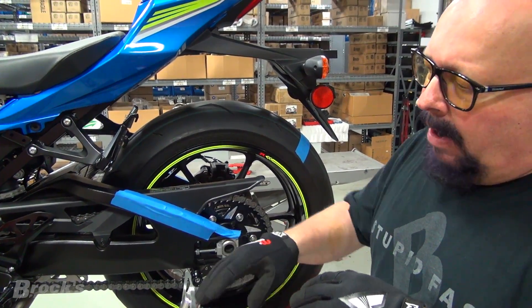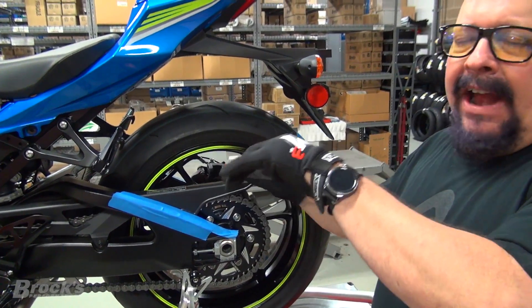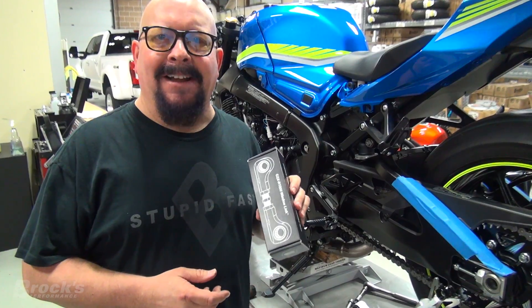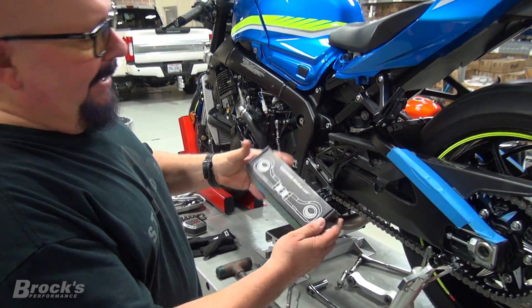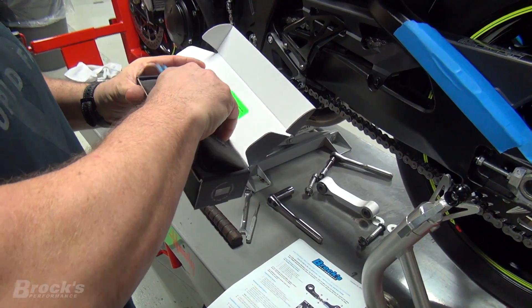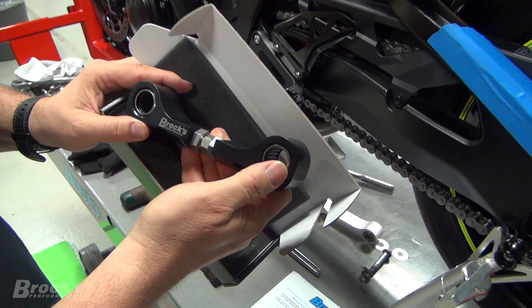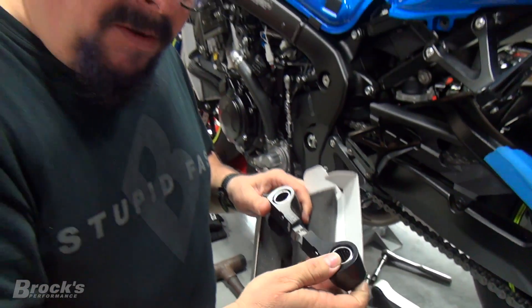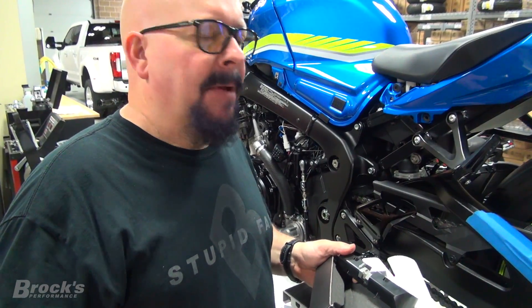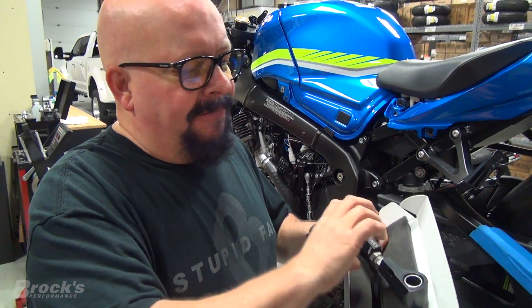So what we'll do - let's do an unboxing video, everybody loves those. Look at the window link packaging. Open it up, we've got some stickers, window link - check that out. Bearings are pre-installed. So why do we call them a window link? I love the idea of adjustable links - they've been around for a long time. The problem is that as you adjust the link and it gets further and further away, you lose thread engagement. I had seen at the drag strip where guys would take off, bam, the back of their bike falls on the tire and they can't move.